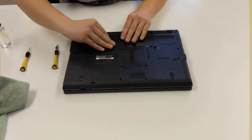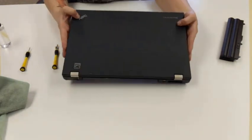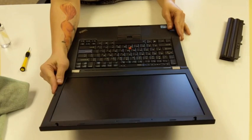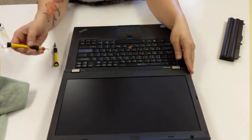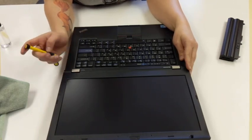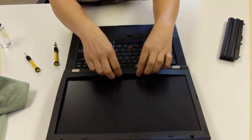I'm going to make sure it's powered off, so we'll remove the battery. On this model, to remove the screen we're just going to pull the bezel right off — it's held with some clips. On some other models you'll notice there's a small piece with a sticker; you'll pull that off and there'll be a screw on each side. So in this case we're just going to pop this right up.